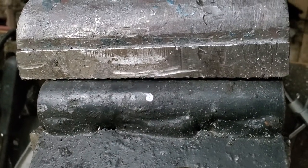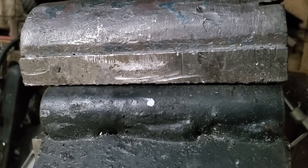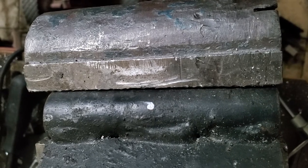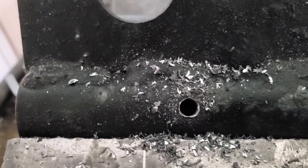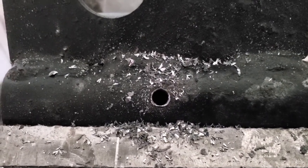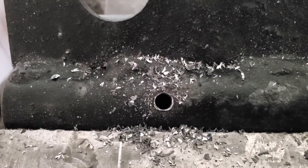On the upper side of the control arm at the widest point, anywhere close to center is fine — it's not really going to matter because there's a void in there between the bushings and that shoulder bolt. Just have it pointing towards the outward part of the car so it's easy to get a grease gun on later. We have the lower and upper holes drilled, ready for tapping. Orient it toward the wheel as much as possible for easy grease gun access.